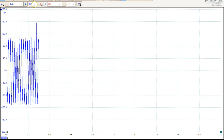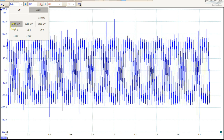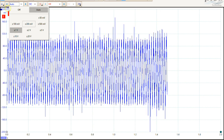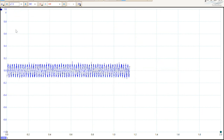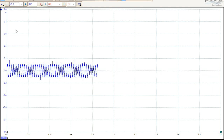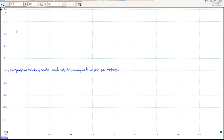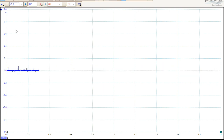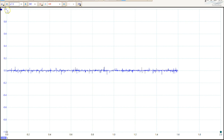We've got DC volts, which is good, and we're going to go for a scale of 1 volt plus or minus. That's just a bit of noise going on, so we'll turn the amp clamp on. That's now on 1 millivolt per 10 milliamps, which basically works out to 10 amps per volt on your screen. You can see we've got positive 1 volt here and negative 1 volt down there. Let's wire up that fan.